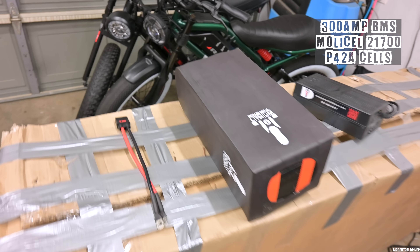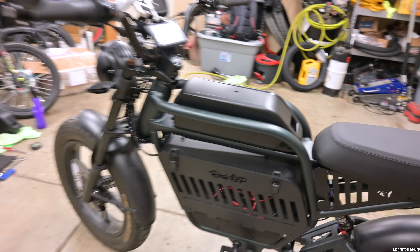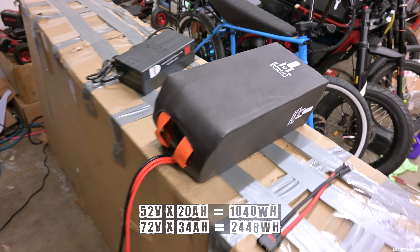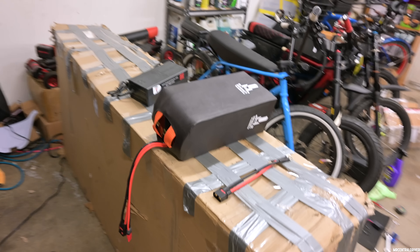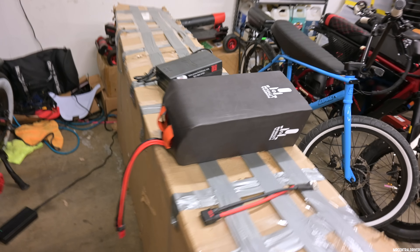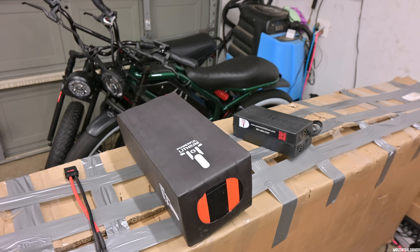This is a 72-volt, 34-amp-hour battery. To put that in perspective, the stock is a 52-volt, 20-amp-hour battery — roughly 1,000 watt-hours — and this new one is 2,400 watt-hours, so that's a huge difference. You're definitely going to get a lot more range with this battery. The only thing I'd suggest is keeping out of full power if you want good range, because you need this big of a battery if you're going to be pushing about 5,000 to 8,000 watts on this bike. The charger also has their number on it, and this battery should be on their website already so you can go ahead and order it.